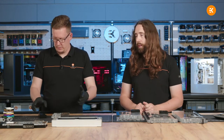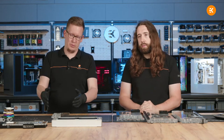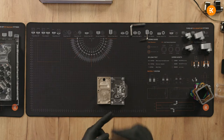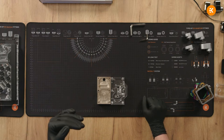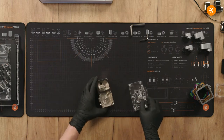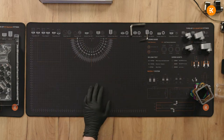We'll clear that up with a video, I think. Yeah, we will make sure that we will have guides of how to use it in a simple way. You can have a tube attached to it, and you can have a drain port at the lowest part of the build, so that if you filled it and you have coolant left in the tube, you just open your drain valve so that all of the coolant goes away, and you're at the safe fill level of your loop. So there are some tricks to how to fill a loop like this.